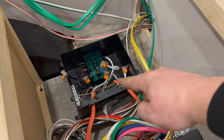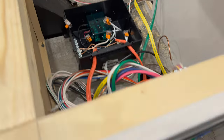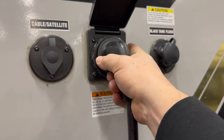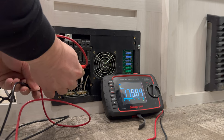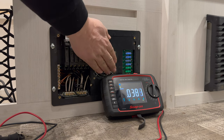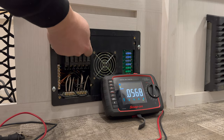Now I'll do the same with the shore power wires, which according to the schematic connect to the lower two connectors on the relay, and the other two will connect up to our inverter. I now have our shore power source coming into the box on the bottom relay connectors, and the upper connectors supply power to the circuit box. Before going any further, I want to plug in the shore power and make sure this works before I continue wiring in the inverter. Checking for power at the breaker to neutral — we have 122 volts. Turning on the main circuit breaker and a couple of circuits — the converter fan is spinning and a fan plugged into another circuit turned on. So it looks like the shore power leg of our transfer switch is working properly. Now we can wire up our inverter and then the charger for the lithium battery.